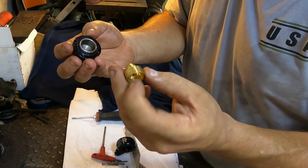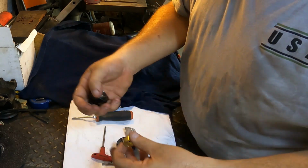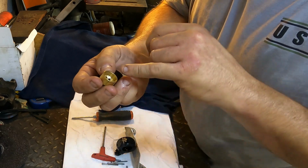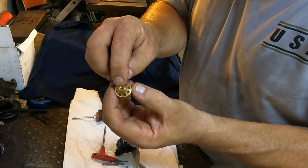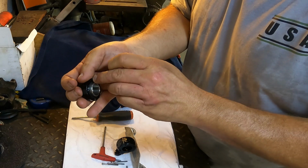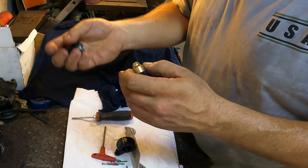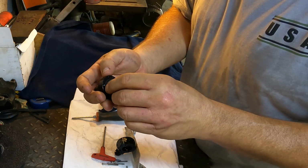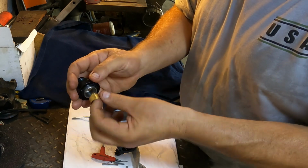And what had been pointed out to me was, well, Jason, before you just go and buy another regulator, that's a good regulator, well made and everything, just check and see if you can't tap and plug your bypass hole in the middle, because then you'll get a pressure reading and everything, and it'll run on a pulse type fuel pump for a cam. Be a lot easier for you to set up. So try that, because there'll be no difference. And I was like, thank you very much. That was a great tip, good advice.